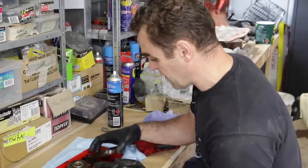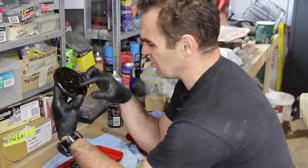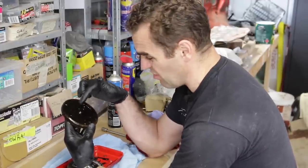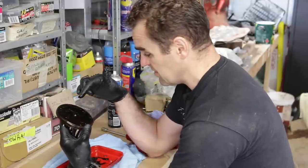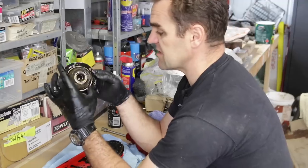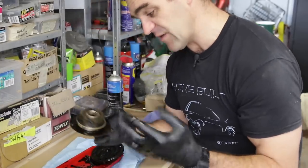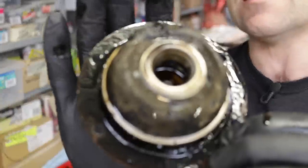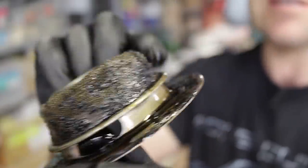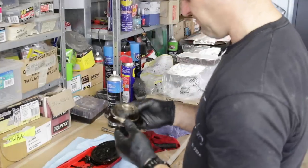Now I've got this stuff out, I'm gonna go through and just have a quick look and see what we've got. This oil is really really gloopy — I can feel a little tiny bit of grit maybe in the bottom, but most of it just looks like sludge. It just looks like this oil has not been changed in a long long long time. First things first I'm just going to give this a big clean up. You can see the screen on this — because these VDubs don't actually have a conventional oil filter, they just have this sort of screen in the bottom. And you can just see the amount of sludge that's built up on this. It's not metallic grit, it's just sludge. Time to clean it up.